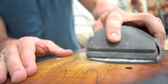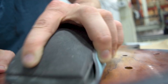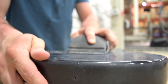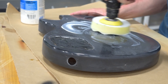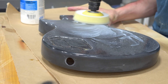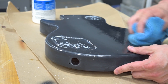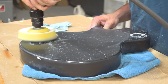I started with 1500, now I'm coming in with 3000, and I'll finish off with 5000 grit. I want to get this as nice and smooth as possible — going up to 5000 makes the polishing process itself faster and easier. Most modern high-quality polishes can buff out anything up to about 1200 grit without too much difficulty, so you don't need to go up to 5000 if you don't want to — that's just how I prefer to do it. I've got my polisher here; you can use a sander if you need to, but a dedicated polisher is really the way to go.